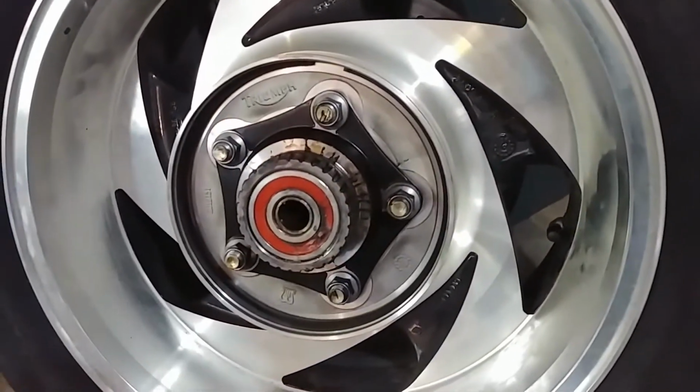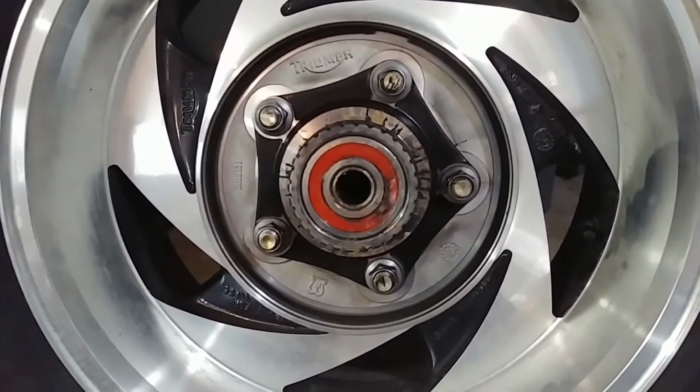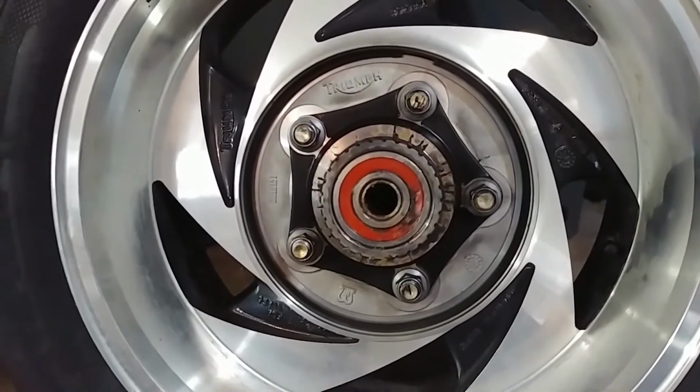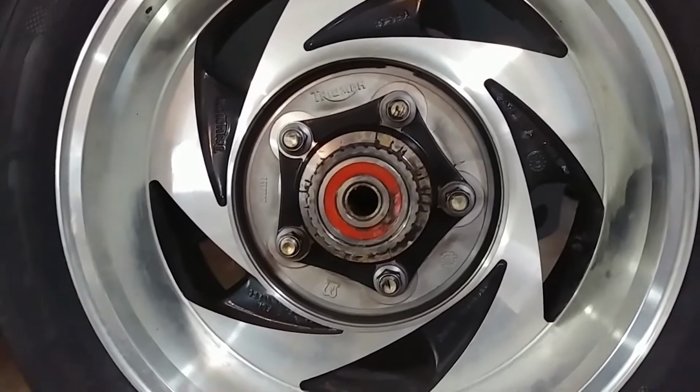So it's obviously a big old chunky gear. So I'm just going to give that thing a quick little cleaning as well, and fresh Moly, and just a very thin coat. And yeah, we should be ready to rock. That should be all the parts that need pre-lubing, and then we're ready to go.